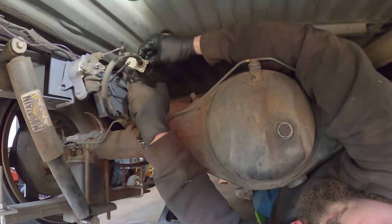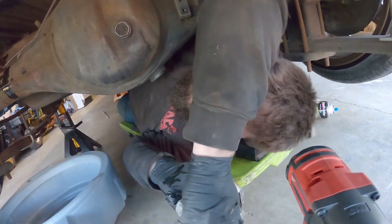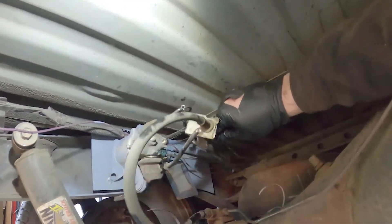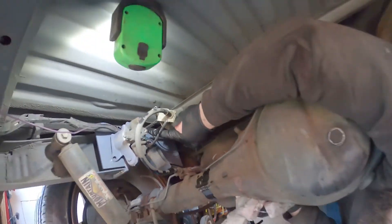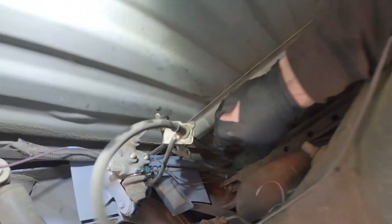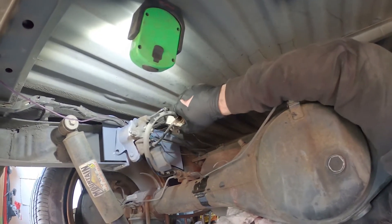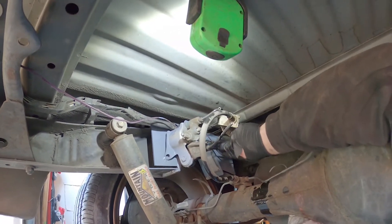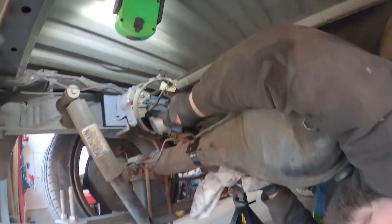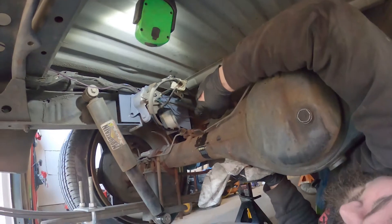So what we're doing here - the brake fluid off my hand - basically to eliminate the load sensor, we took this feed line, ran it off, took it off the load sensor, running it straight back to this back brake line. Now we've got to get this load sensor and garbage out of the way. Get this line off - this is the one that goes to the front - get the load sensor off, and then we'll reattach this to the frame. We'll have free real estate at that point.